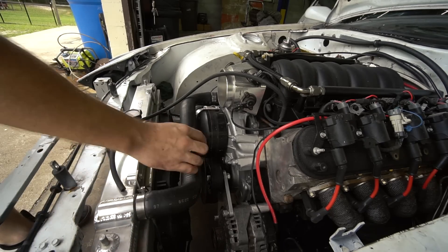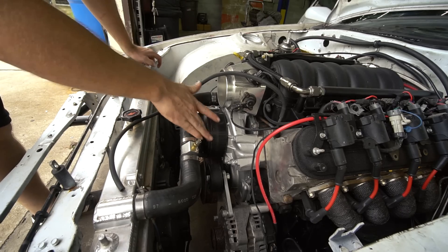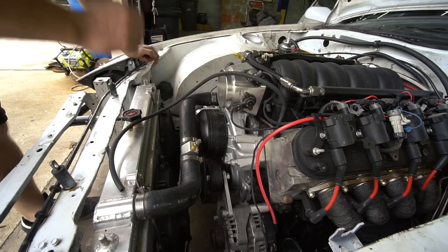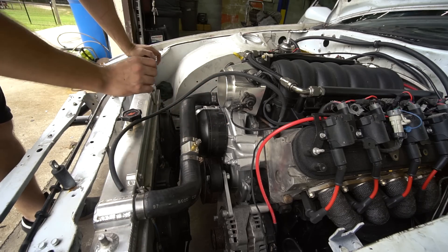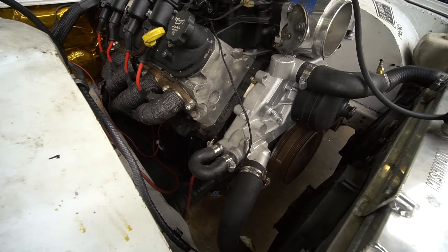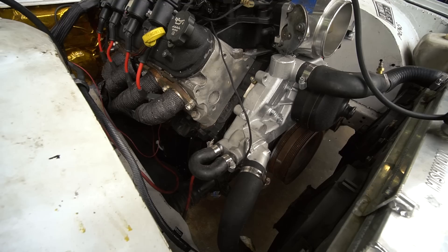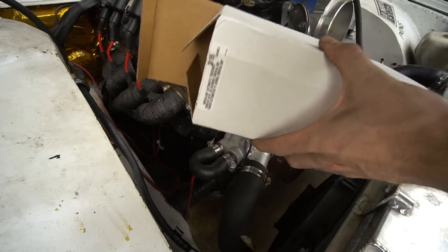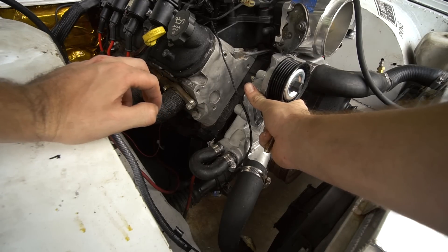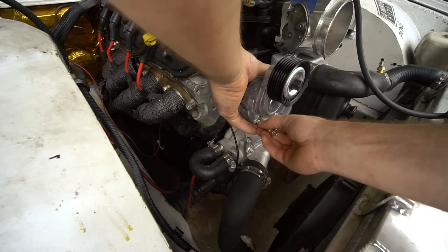The first and most important thing we need to take care of is the serpentine belt and cooling system. We have no coolant, and it doesn't really matter because we have no belt spinning the water pump or the alternator — so we're running off battery with no coolant. I emailed the guys at Dirty Dingo; they make this bracket kit that spaces out an F-body water pump to work with the stock truck crank pulley so you don't have to change the crank pulley. They confirmed an F-body tensioner will work, and it totally makes sense because it matches the water pump.